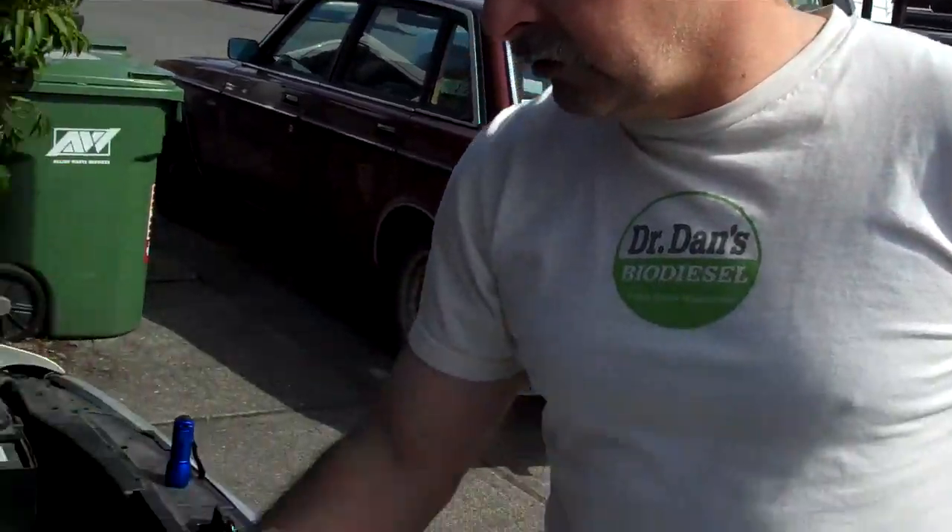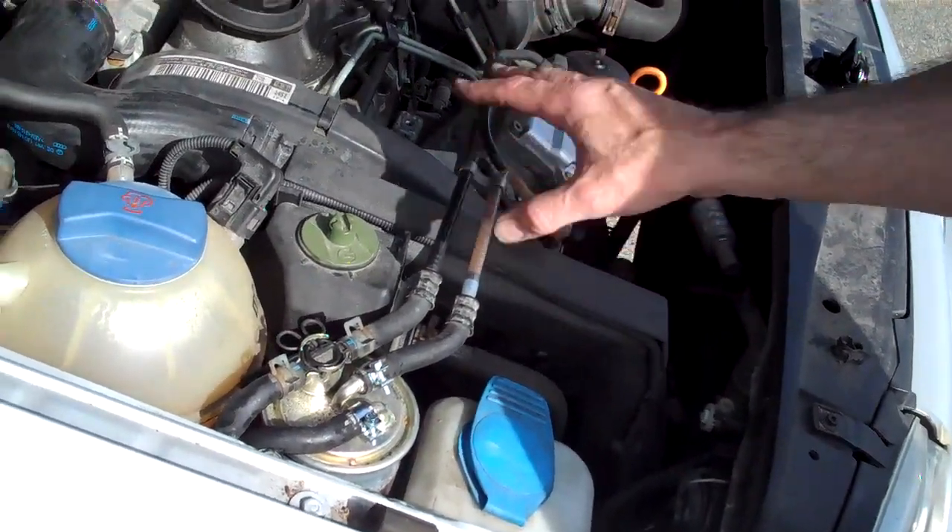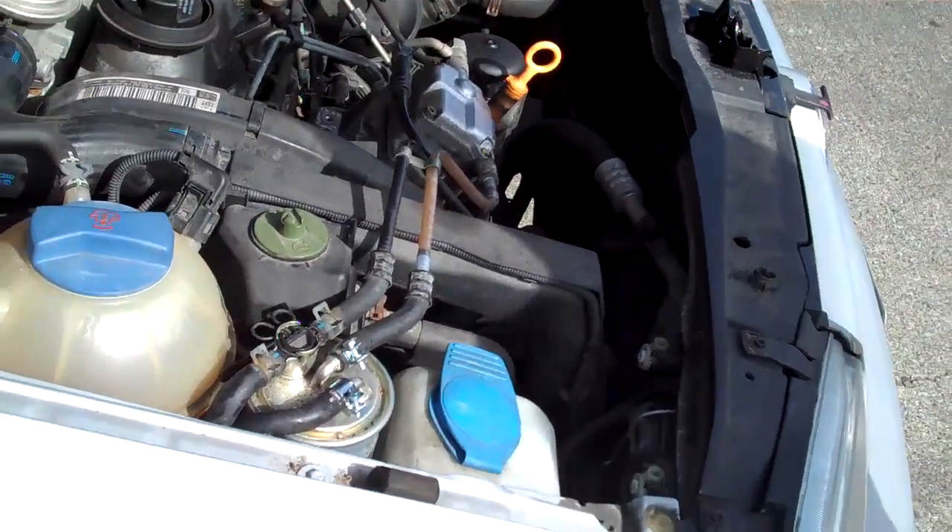Air is going to go in a loop for a while here until the fuel reaches full temperature and returns back to the tank. So don't worry about seeing a little bit of air in there. The big thing you want to notice is did it change how the car ran? Pretty much any time your car runs differently, the first thing you want to do is check and or change the fuel filter. I just can't tell you how important that is — how many thousands of dollars of damage we've seen from a plugged fuel filter. See you soon.